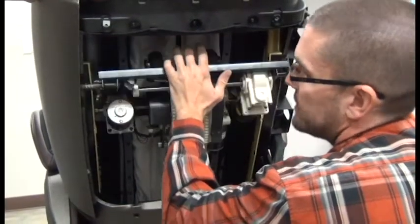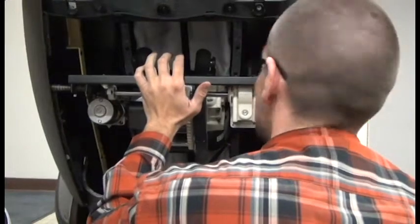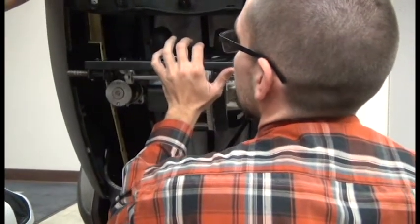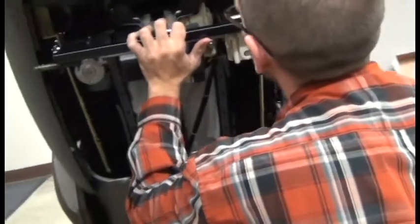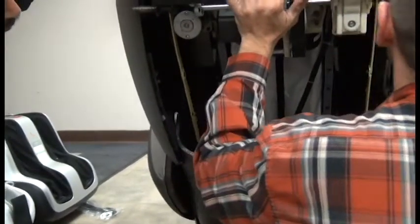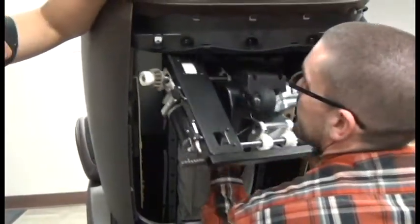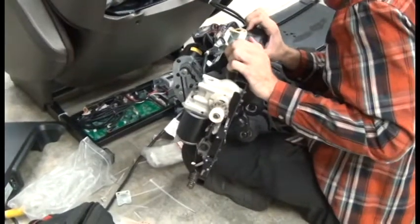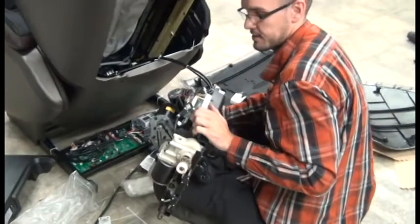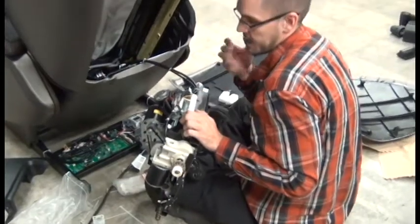We need to get it out this gap right here — we're almost there. Tell the mechanism to keep traveling up, go a little slower, and we need the bottom two wheels to reach the maximum. As soon as you hear that noise, you're there. Then it's just a matter of lifting up — balance the massage mechanism on your knee, a toolbox, anything like that, because the cable has limited length and you can't set it on the ground, only about six inches.